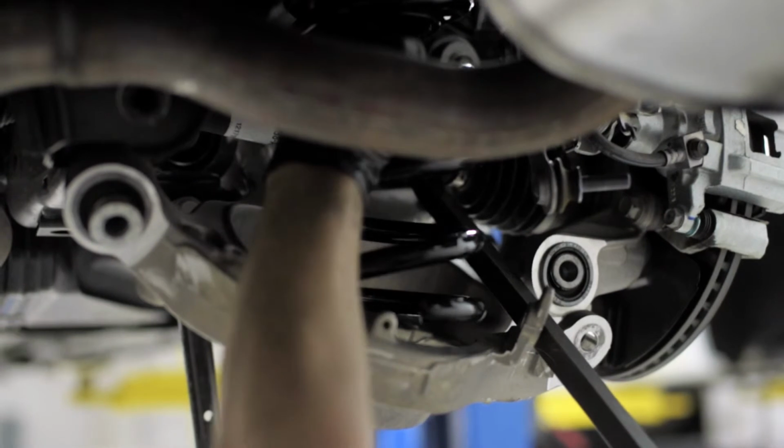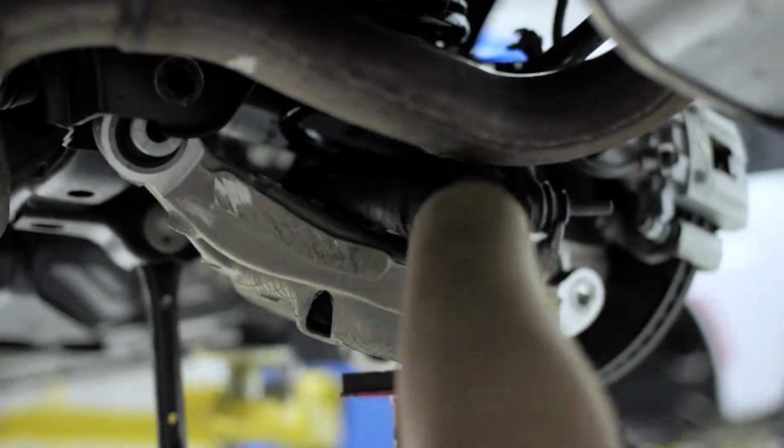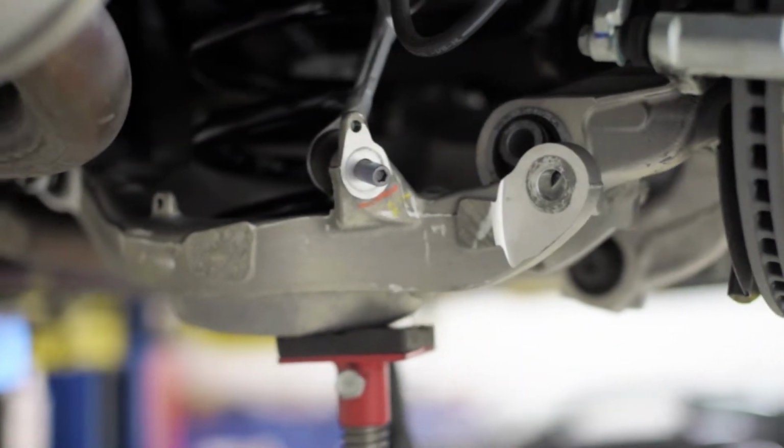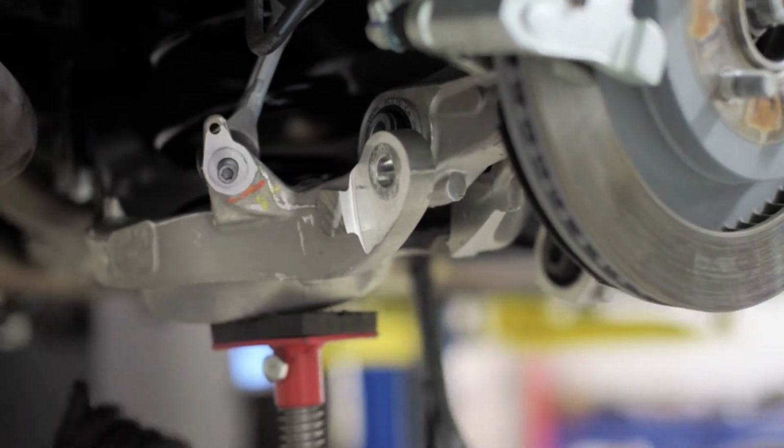The new seat goes on top of the new Ksport spring. As it is shorter than the OEM spring, it will go in much easier. Using the screw jack once again, lift the LCA back into place and use a pry bar to help the bushing seat between the knuckle and subframe.